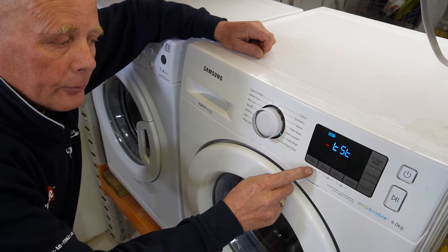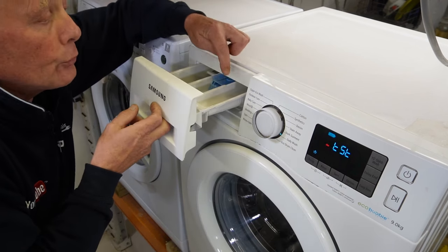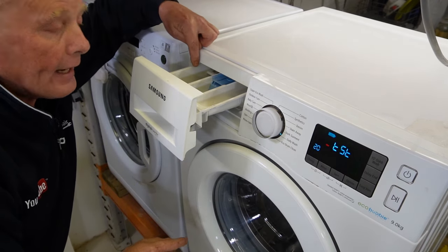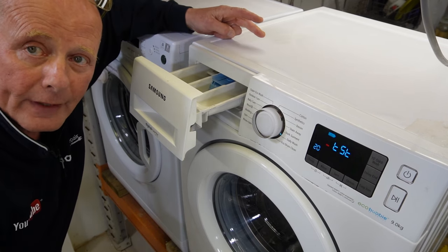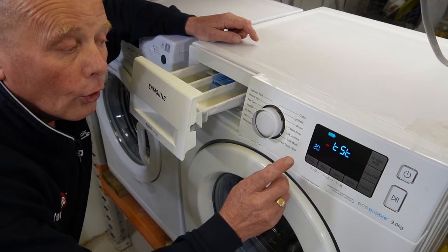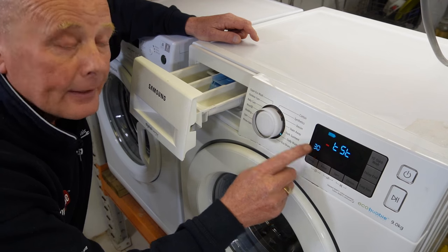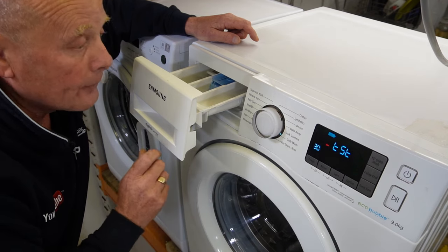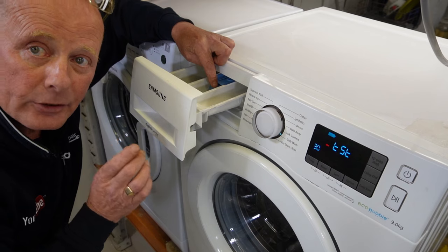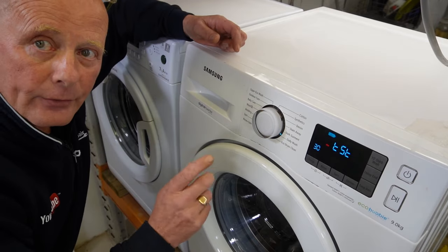So let's go through these individually. First button: press it once, the water symbol will show up and you will notice water going in on the right-hand side of the soap door. Press it a second time, the water stops and it starts coming through on the other side. There are two water valves on this machine and this is testing each individual water valve. If you have a washer dryer or a machine with three water valves, press it a third time to activate another water valve. The reason why the central compartment doesn't get water in this test is both valves need to be activated at the same time for water to go into the conditioner tray.